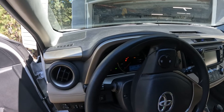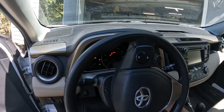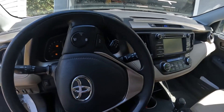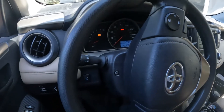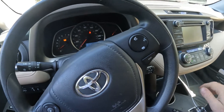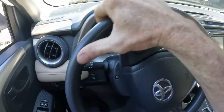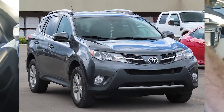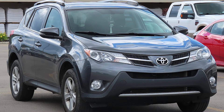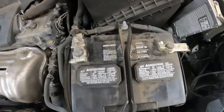Let's see if she fires. There was no battery light on when they drove it up. We've got some slow crank action, but no battery light, so probably not the charging system. This is a 2013 RAV4 with the four-cylinder — they quit putting the V6s in them.